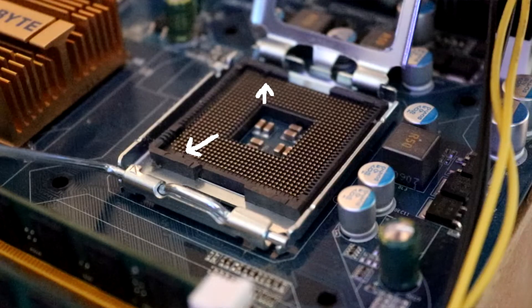The difficult bit involves the knife. You need to take a look at your LGA775 motherboard socket and you will see two protruding little bits of plastic that stop you from installing your CPU in the incorrect orientation. For this LGA775 mod, we need to install it in the incorrect orientation, so those need to come out. Take a craft knife — nice and sharp — and be very careful removing those, because if you damage your socket you will break your motherboard. Also be sure to check that your LGA771 CPU and your motherboard are compatible; links for websites on how to do that will be in the description.